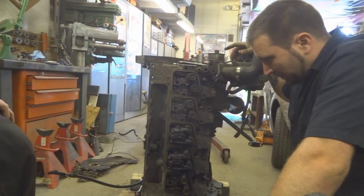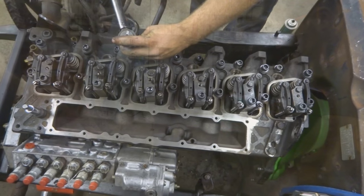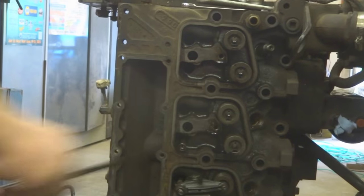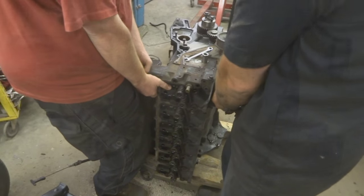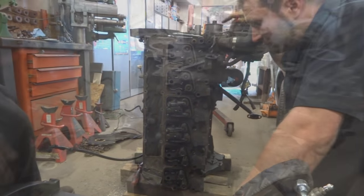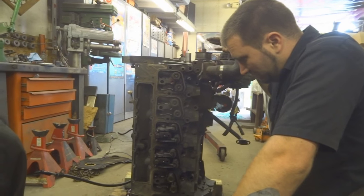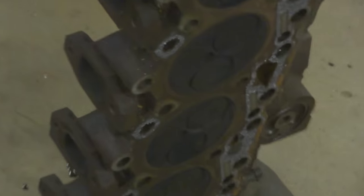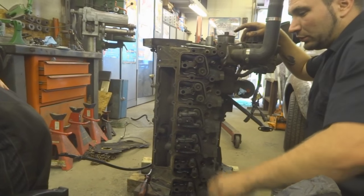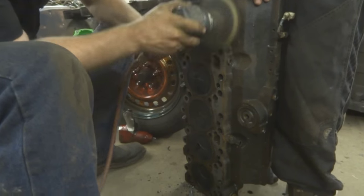And then that's exactly what we end up doing with those socketed cap screws, except you can pull them off. We take those down, and when we do that last 90 degrees, we actually also set the torque wrench for 150. So that ends up being really close. If it clicks before we hit 90 degrees, then we stop. If it hits 90 degrees before it clicks, then we stop. Mainly we do that simply because we don't have a tech angle torque wrench to measure the angle of turn when you get towards the back of the head on a second gen. These back two cylinders are under the cowl, and you actually have to ratchet your torque wrench. With an angle gauge, you can't get away with ratcheting your torque wrench. It doesn't keep track of the angle.